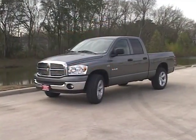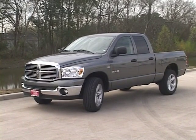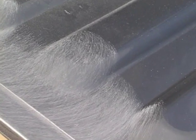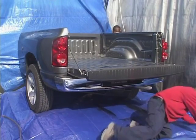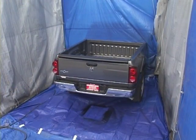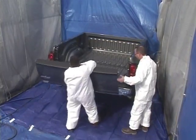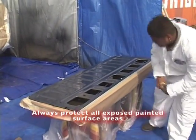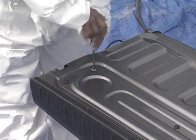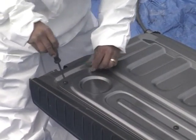Preparing the vehicle is simple. The surface must be clean, dry, then etched to allow for proper material bonding. Protect the cab from overspray by draping a tarp from the ceiling or overhead frame and position it between the bed and the cab. Begin by removing the tailgate and set aside to prep and spray. If applicable, remove bed bolts and tie-down hooks or loops.